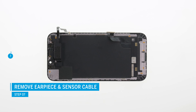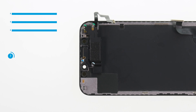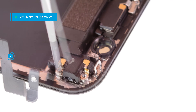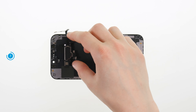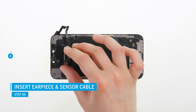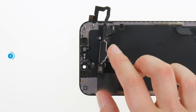The sensors for Face ID are integrated via a sensor cable on the earpiece. You have to transfer the earpiece from your old display to continue using Face ID. To remove the earpiece including the sensor cable, unscrew the two Phillips and two Y-type screws that secure the module. Fold the detached earpiece around and use a flat sturdy tool like a steel spatula to carefully lever the sensors from their guides — be especially careful not to damage the sensitive sensors. Position the earpiece in the replacement display, press the sensors back into their guides, make sure they are all seated evenly, then flip the earpiece around and fix it with the screws.